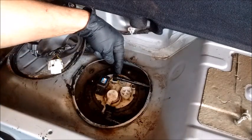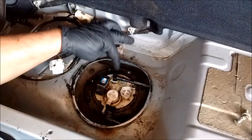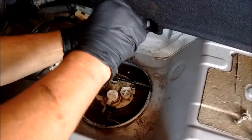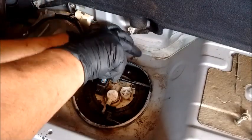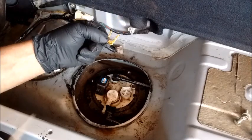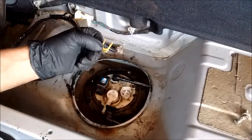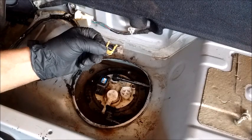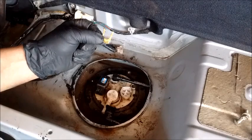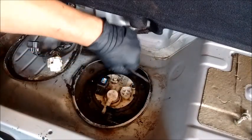Next is the main fuel line. The main fuel line has a yellow locking clip — a little locker clip made out of plastic. To remove this yellow locking clip, get a flat blade screwdriver, wedge it in, and just by levering it out, it comes out. Now, this is a non-reusable item. Many people reuse it — many people say they've reused theirs many, many times, and that's fine. The Toyota repair manual states that this should be replaced on every use, and I will add the part number for this at the end — it's like a $2 part. Now that we've removed the clip, we can just pry up the fuel line and we're good to go.